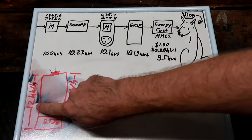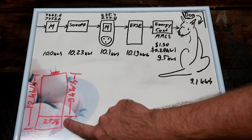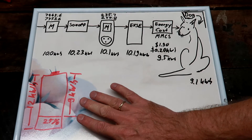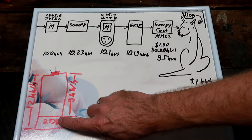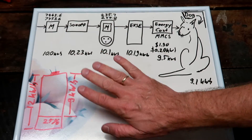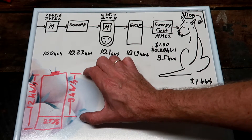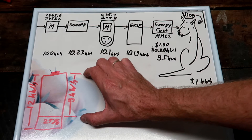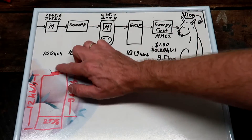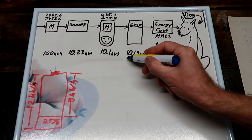The battery has a 12 kilowatt hour total capacity. We left the car at 25% — confirmed by the PHEV watchdog — when the engine kicked in. It might be 25.3 or 24.5 in your case, but 25% is a good average to assume. So 25% was still in the battery, which leaves 9 kilowatt hours that could potentially be recharged to bring it back to 100%.